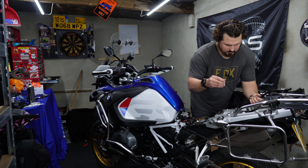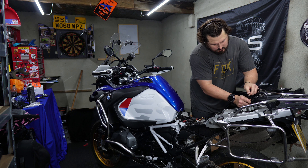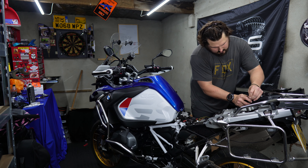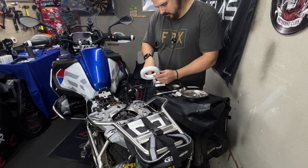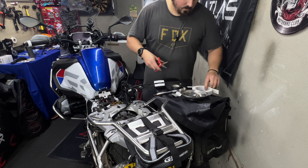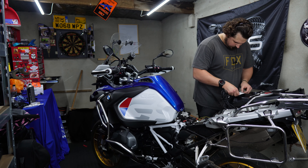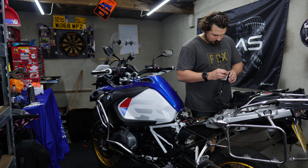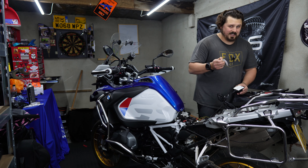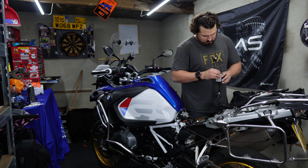What I'm going to do now is clean and stick on the front and rear cameras, add a little cable tie on just to make sure it's doubly secure. Install the brain unit like I said at the start of the video — which was yesterday. Taking out the back bit of the rear, sliding it in, double-sided sticky tape. Tidy up all these wires, make sure they're all tucked away nice and neat, then put the seats back on and put the tank cover back on.